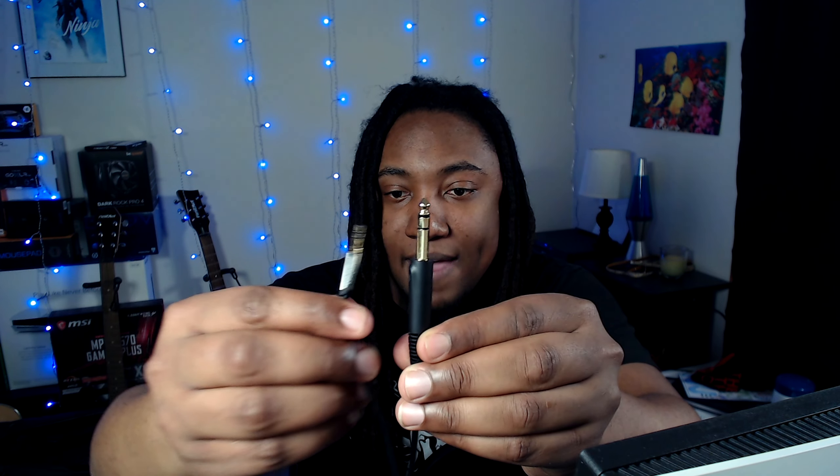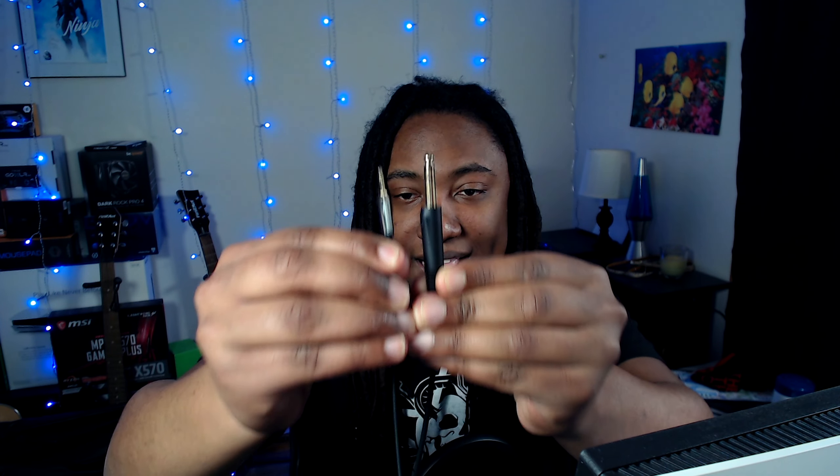This is the headphone plug-in basically, and that's not like a normal headphone plug. It plugs into right here — it's a 6.5mm jack — and most headphones are 3.5mm. For comparison, here's the normal headphone jack — a 3.5mm aux cable — and here's the 6.5mm. Look at that difference, look how huge this thing is.